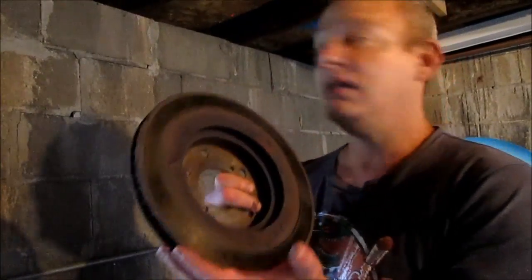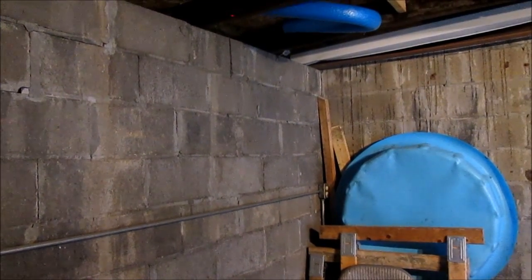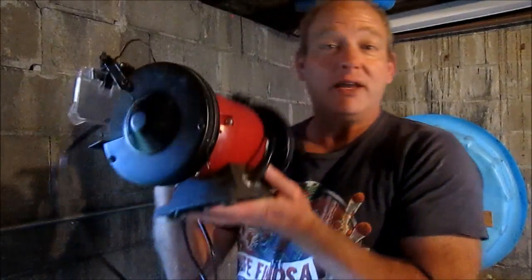This rotor, guys, the rotor here, defective, worn out. Okay? Hold on a second. I had to take those brand new brake pads and put them on the grinder to make them fit. That's how weird things can be. Anyway, safety's job 1. 2, don't get oil and grease on the pad material. Big mistake. It's hard not to. You're playing with grease and you're playing with brake pads. If your fingers are greasy and they touch the brake pad, problems. Right?